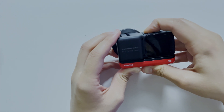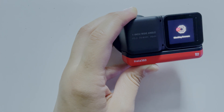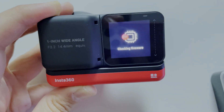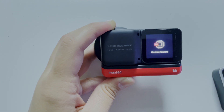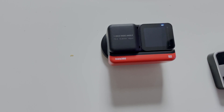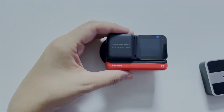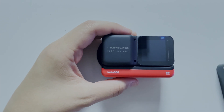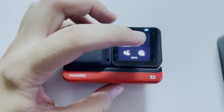After we did that, we will see 'checking firmware' on the screen. This will take a couple of minutes — maybe one or two. Then the camera will stop working and the screen will go blank for another one or two minutes while it's doing its process inside. Afterwards it will turn on again and you can check if the update was successful by going into camera info.